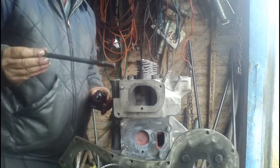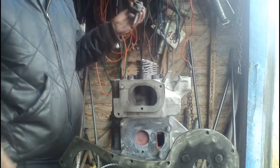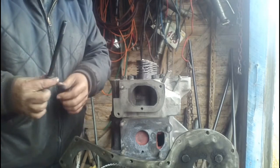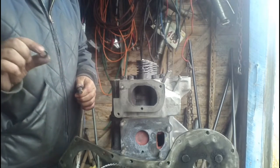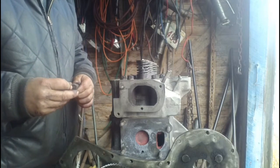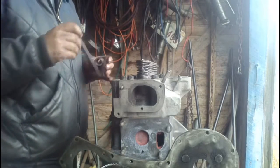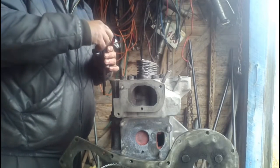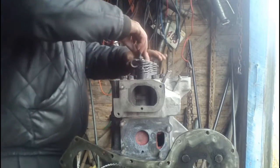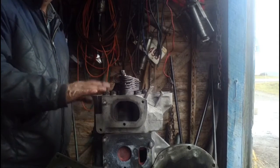There's one long bolt that goes down through the center post of your rocker arms. You want to make sure that you get the proper washers back on these — they don't use lock washers, they use a grade 8 flat washer. They're an extra-hard washer specifically for this purpose, to put the right pressure on the head to make everything seal. Torque specs for this head call for 70 to 75 foot-pounds.